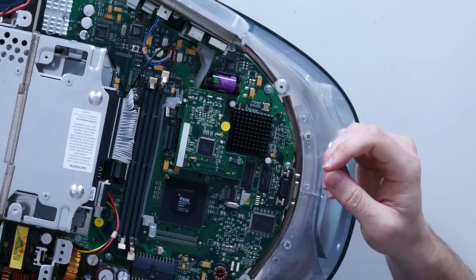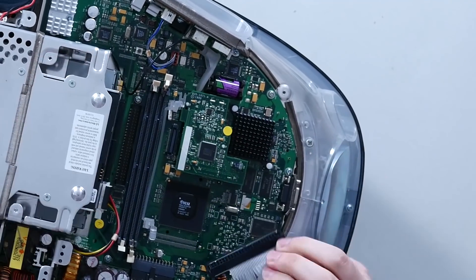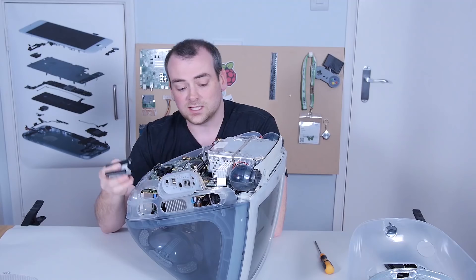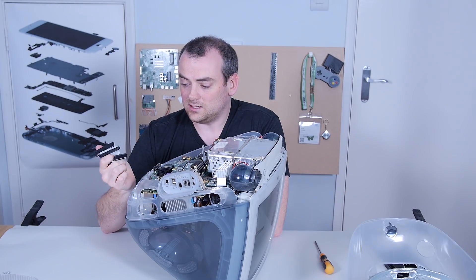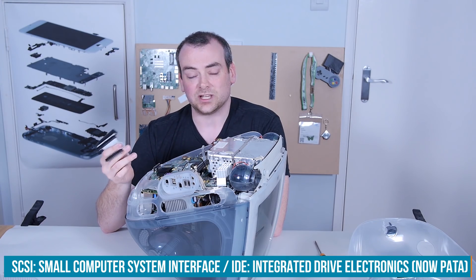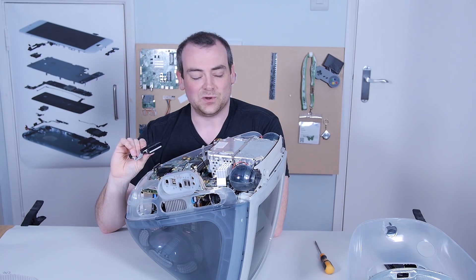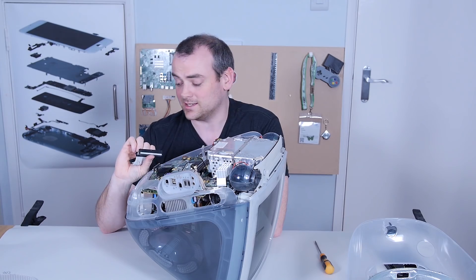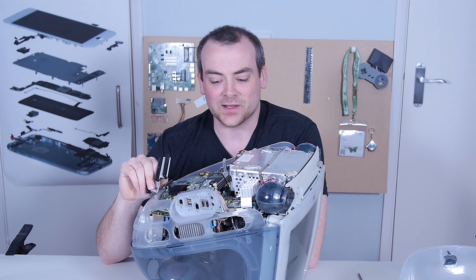The hard drive and the CD drive are interesting components in and of themselves. The hard drive looks like an otherwise reasonably standard device, but if you compare the connectors to the main connection on the motherboard and the CD drive, they're enormous. This is because Macs at the time used SCSI as an interface instead of IDE — a little bit redundant now as everything uses serial ATA normally, but IDE was the standard across x86 PCs. You could get SCSI cards, and typically you saw them in servers, because you could connect up to eight hard drives to a single bus — particularly useful for RAID arrays. Anybody used to modern storage speeds, especially solid-state, would be staggered at how slow this is, and also that spin-up noise. When I tested this before we tore it down, I found the sounds of it starting up and the buzz of the monitor incredibly nostalgic.